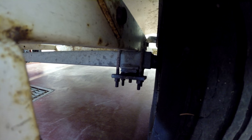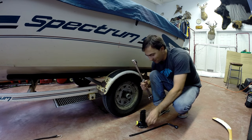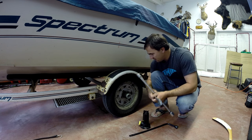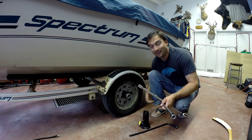So be careful if this happens. Always pay attention when you hear those clanking noises behind you from your trailer. In order to do this repair you need a tire iron, a jack, and you want to loosen off the bolts before you lift the trailer up, or else the wheel will spin and you won't be able to get them off.